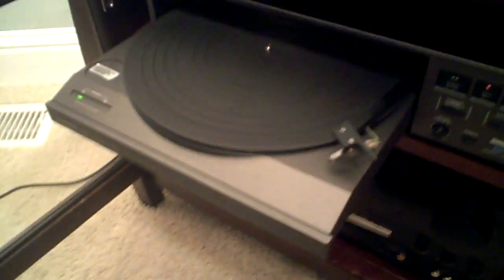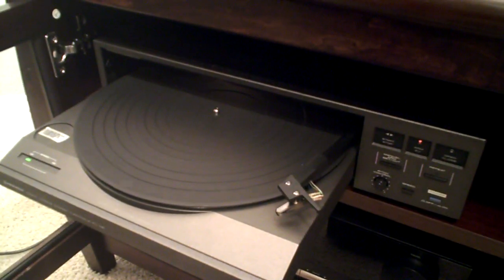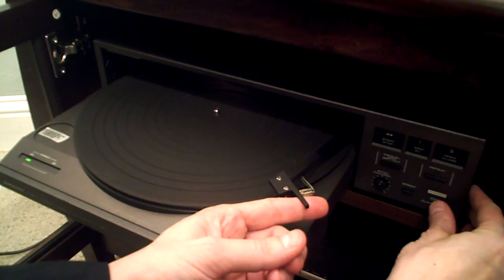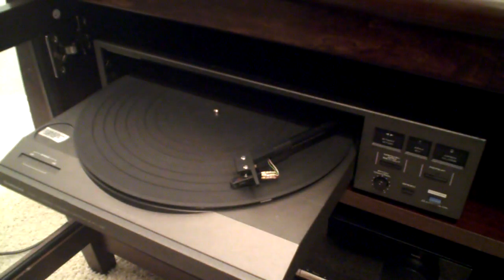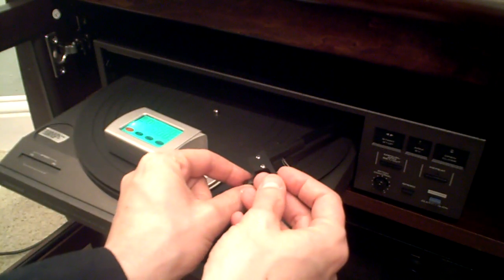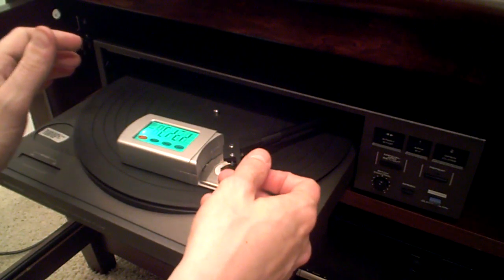Now I'm going to get the turntable. This particular Pioneer PL-05 needs to be in just the right state to check the tracking force. We're going to electronically tell it to drop the tonearm, then shut down the power. Now that it's not spinning, we can safely put it onto the tracking force gauge. We remove the protective nose cone and very gently set the tonearm on there. We have a reading of 1.77 to 1.78 grams, basically, which is pretty close to what I want for this cartridge on this turntable.